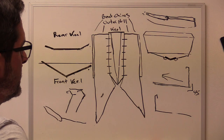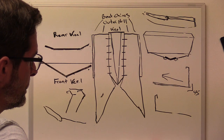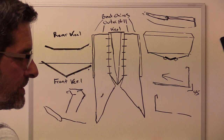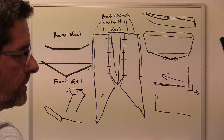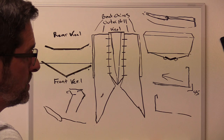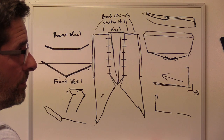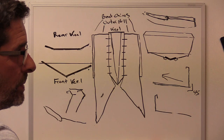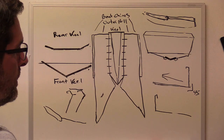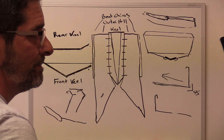So if you buy one of these kits and you have it shipped to you, I would say call Wattscraft, ask them, see if they'll give you all the bend specs, and then, you know, get whatever tools you need to check those bends, and check them every way to Sunday. And make sure for yourself, I just wouldn't trust it, that your bends are right.